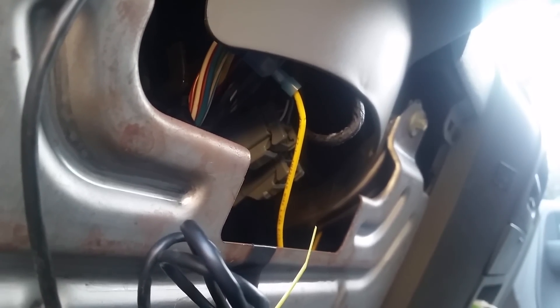I'm not going to pull a whole bunch of paneling off, but I want to focus on this yellow wire underneath my steering column. It's connected using a T-tap — just the way I chose to do it; if you've got room to splice it correctly, I definitely recommend that. It is connected into another yellow wire which comes down from the multifunction switch, and that is the high beam trigger wire. If you're going to do this, post on a forum or Google for your vehicle's wiring diagram to find the high beam trigger wire coming from the multifunction switch.